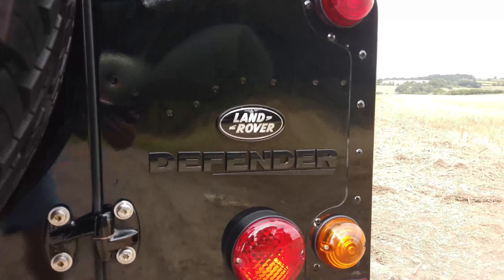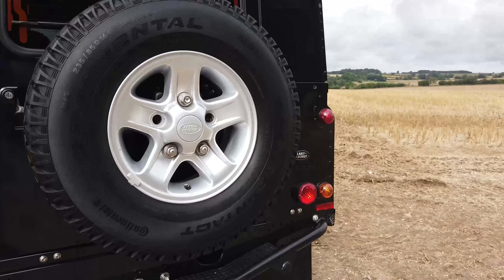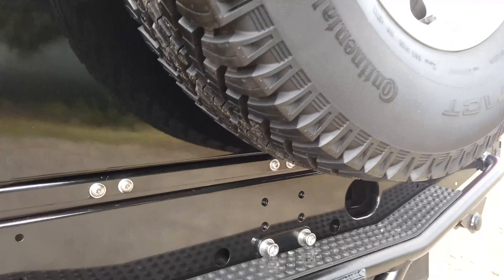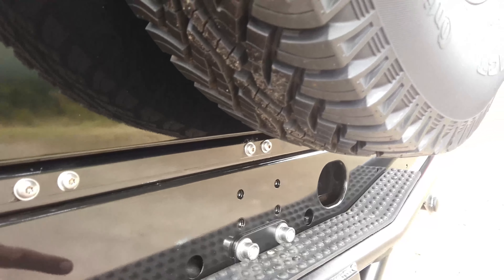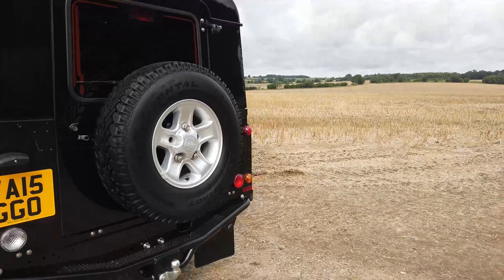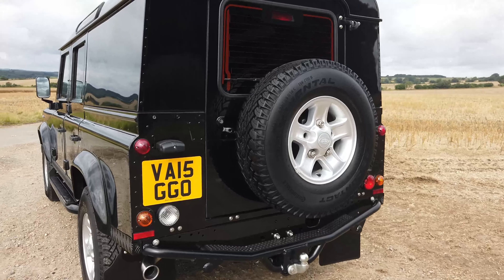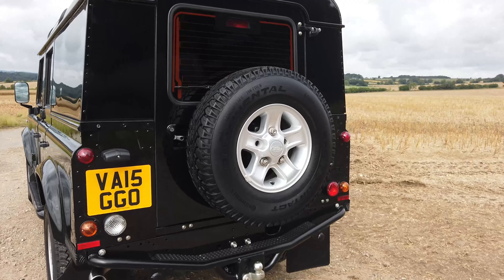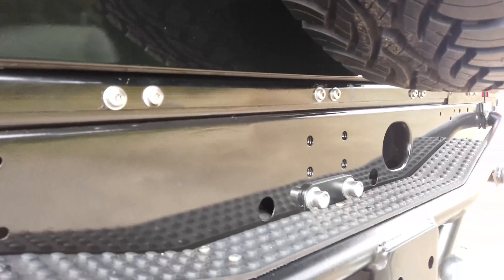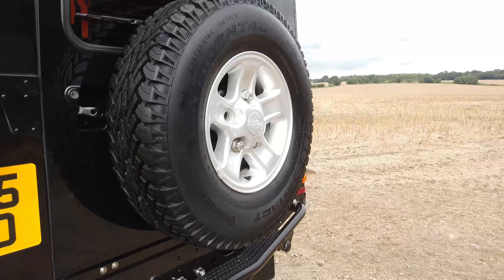Black badge with black lettering — it just makes it look good, makes it look smart. The tow bar is stainless — it's all about making it look fresh. This car was bought from Land Rover by the previous owner. They had painted the rear cross member but hadn't actually sanded it down — they just painted over rust. So we sanded it back to bare metal, which took about an hour and a half to two hours, and then we treated it. I think that's eight or nine layers of the best rust-proofing paint you can possibly get.